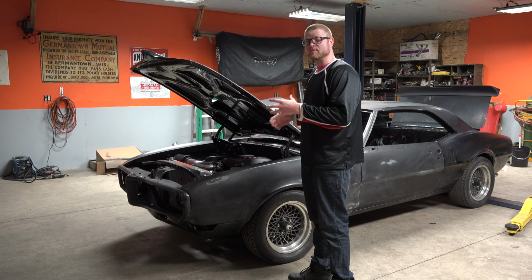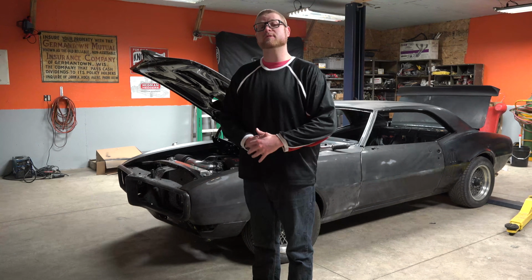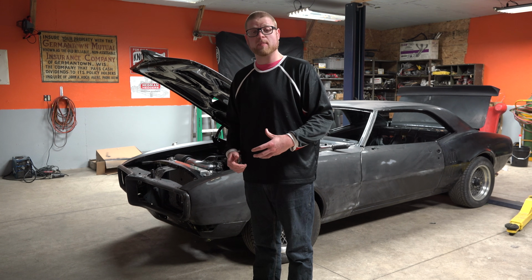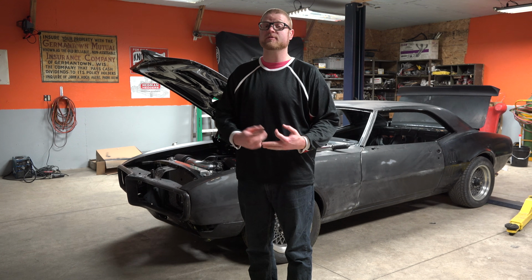There's a lot of work that needs to be done on the body, which is kind of why we're here. Now the whole thing is currently stripped, meaning we're going to take the opportunity to seal off any bare metal that's been replaced on the interior, get a layer of primer and color on the whole thing, and then come back for areas like the dash and deck lid that are going to be exposed, make sure we have even more color on them, sand them, and hit them with some clear.